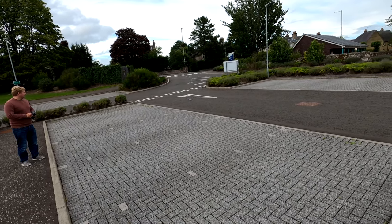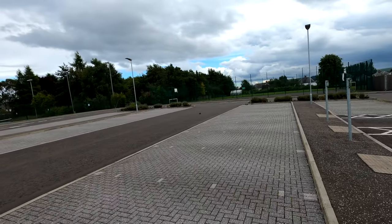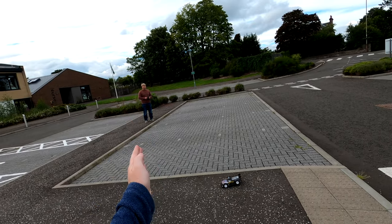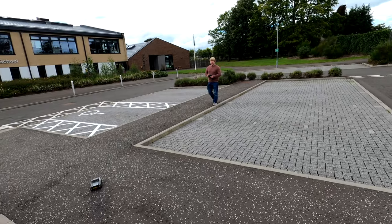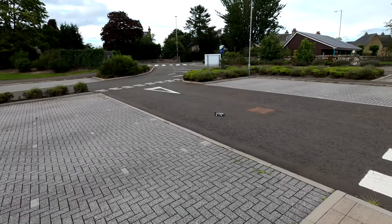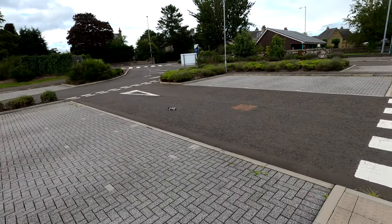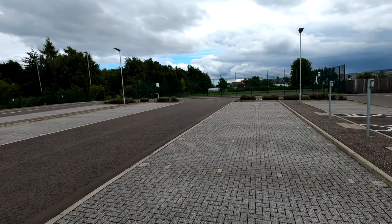So, this is me hitting the throttle now. Yeah, there's an awful delay. Very juddery and bouncy on those pogo sticks. But at least your tracks arrow straight. I don't know what was causing mine to do all this. Oh yeah, it does. It's not absorbing. It doesn't have shock absorbers. It's just got springs, so there's no damping whatsoever.